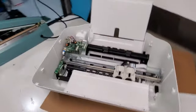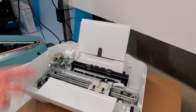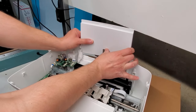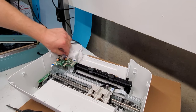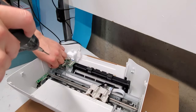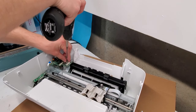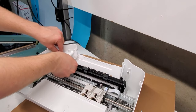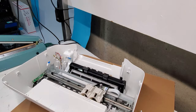That's basically how you go in and take care of the problems. The rear tray — you just push it in the middle, push it to one side, and pull one side out. Now I'm going to remove the formatter board, or logic board — some people call it the motherboard, or just the printer board. There are three screws that hold that board down. I've already disconnected almost everything — there we go. This is the control board for this printer.